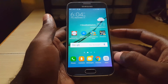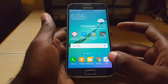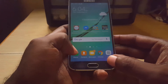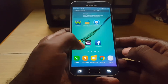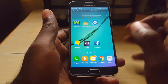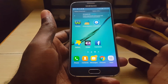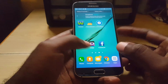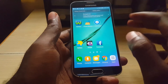If you have a similar device giving a similar issue where the touchscreen at various times becomes unresponsive — the display would become unresponsive as soon as the phone was used for a while. One way I noticed it would start is if I went into the gallery and started moving through pictures — the phone would then freeze up. I would have no touch functionality. I noticed the home button would work, the power button would work, volume up and down would work, but the touch would just go dead — locking me out so I could not enter my password.